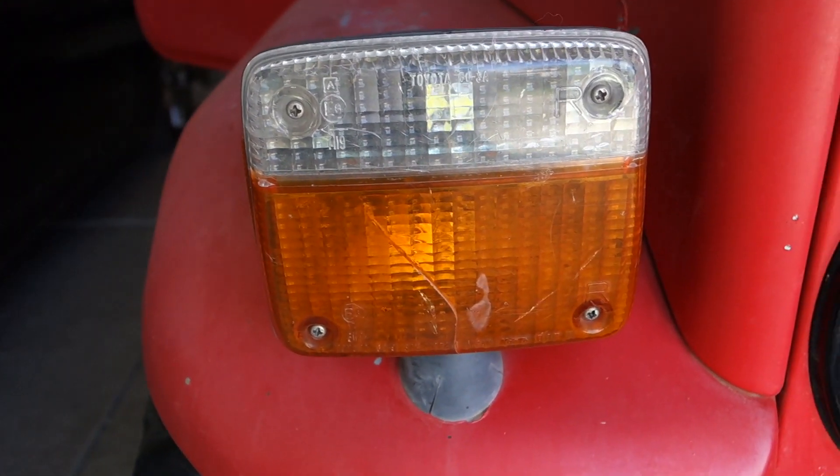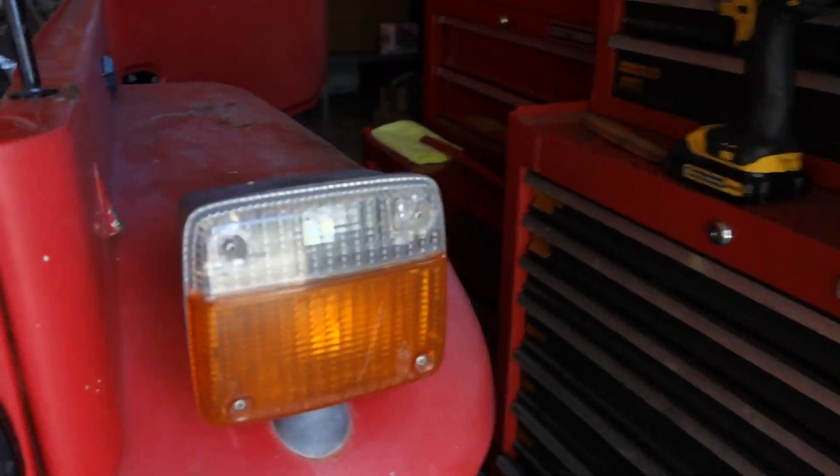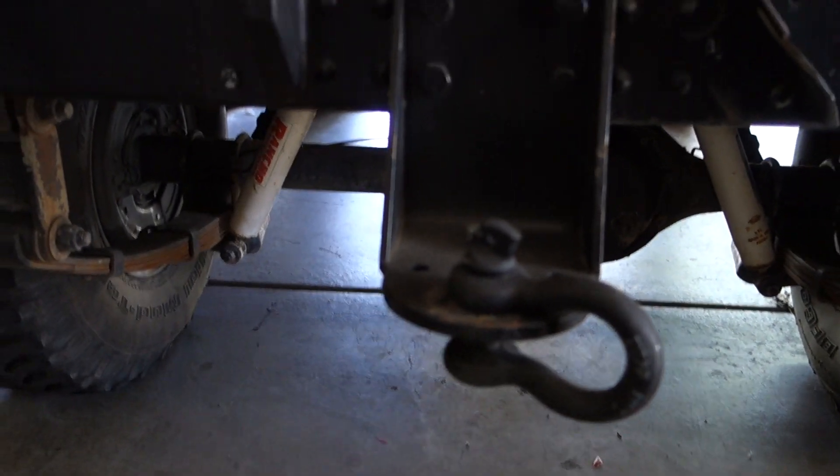These have LED bulbs in them and they look kind of weird because they're white, and I like the orange nostalgia. So I'm taking all those out and putting 1156 normal bulbs — those are going back to halogen, and even the taillights. 1156 here, 1157, 1156, the standard. And then those, I might put LEDs in them or just keep them as reverse slash rear lights.